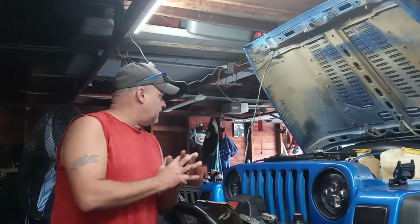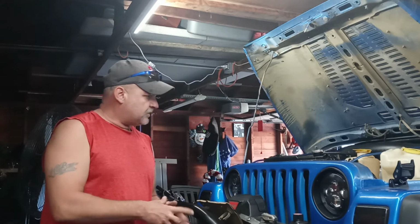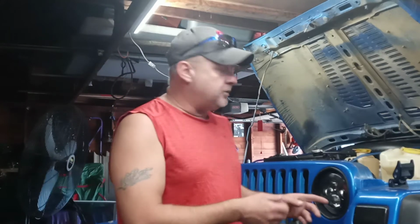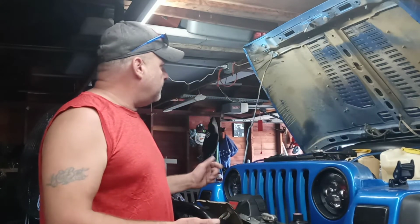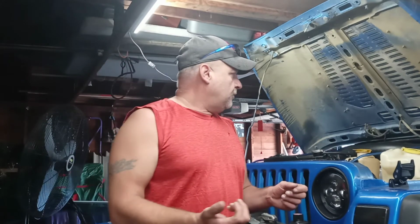So, I think I went over everything as far as the critical stuff for startup. So I'm going to go through the process with you now. Oh, yeah, but have a friend up there with a flashlight watching the fuel lines, make sure there's no gas dripping down, make sure your fittings are still good. Another thing to look for, just the obvious things, water or oil shooting or spraying from somewhere.